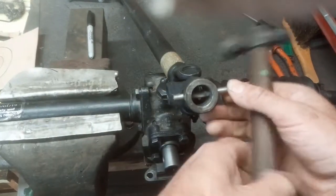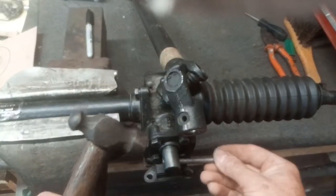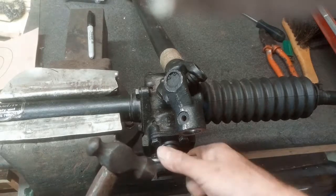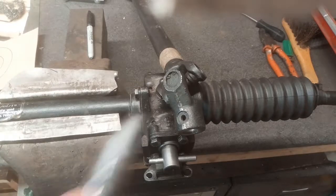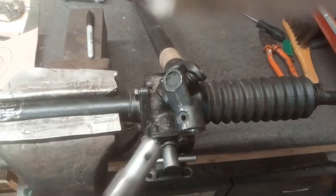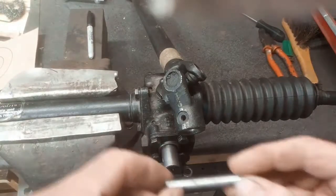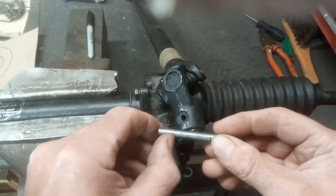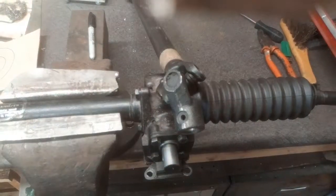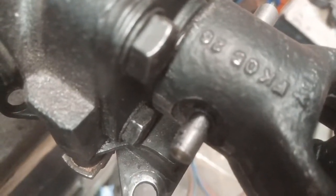There I've got not quite halfway. If we try it on this — that's very nearly halfway, exactly what I've got on that one. So I'm going to assemble it, push the pin through, mark the end of this pin where it leaves the yoke, and thread it up to there. There we are, pins in. I've marked it with felt pen on the end of that pin.